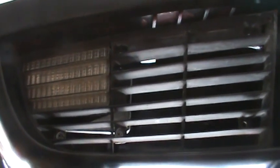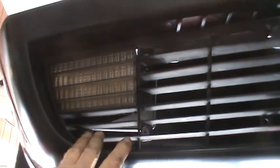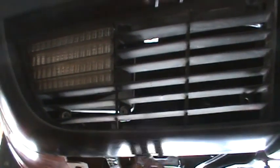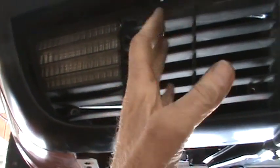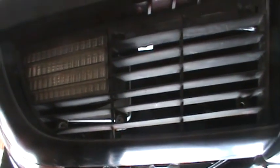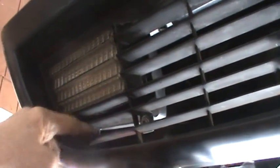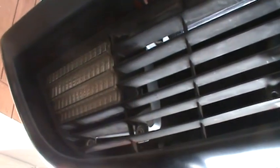After a bit of struggling, I finally got the passenger side parking light and turn signal installed — it was difficult. First of all, this is best inserted from the backside, which means you can't have any of the bottom pieces off. I was able to put it in that way, and then there's this bracket that goes in back here — you can see the silver binder — it's got three screws that attach to the grill.